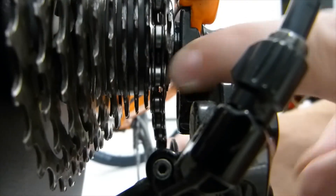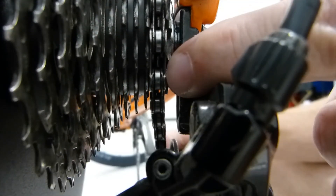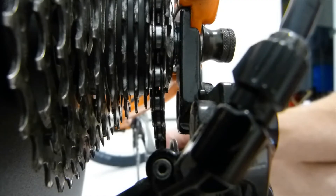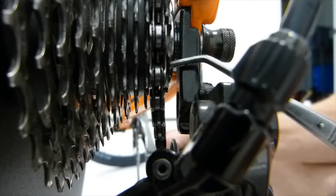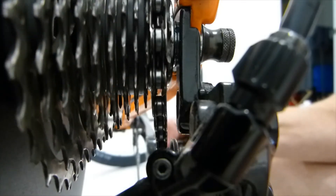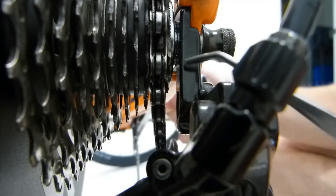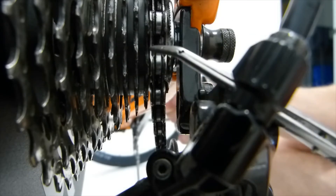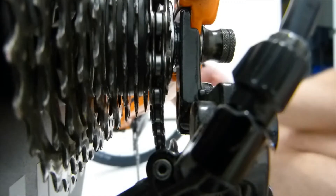So the chain slips back to the second sprocket, where it is at the moment. I hope that makes sense. The derailleur just needs to be moved out — I'm going to move it out with my hand, like so. It needs to be here in order for this shift to take place. It could be manipulated with cable tension, but then the rest of the shifts don't work, because so much cable tension just needs to be present for the other shifts.